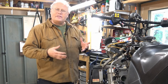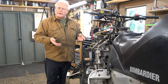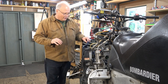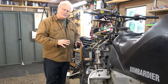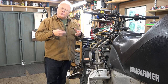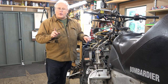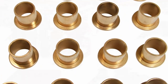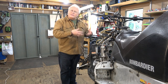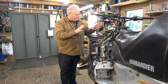Over the years Skidoo has upgraded this suspension and changed some of the angles, but essentially it's the same thing. The one weak point, in my opinion, is that Skidoo always used Delrin bushings inside the control arm mounts. These are fine and function okay, but after three or four maybe five seasons they start to get loose. The solution is to re-bush the suspension — you can use more Delrin bushings, but there's a better solution: oil-lite bronze bushings, and the whole set was about fifty-five dollars.